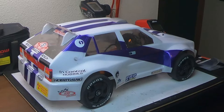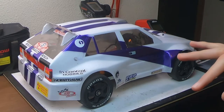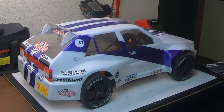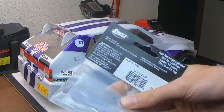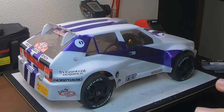All of these new exact parts are going in. The only thing being salvaged from the differential that's in there now is the ring gear, the outputs, and the pin for the outputs — everything else is being replaced. This is actually the upgraded version with the newer Tenacity gears, because this is an original Losi Tenacity T, and the newer gears are a lot stronger. I'm going to take the body off and put you guys on time-lapse so you can see me disassembling it.